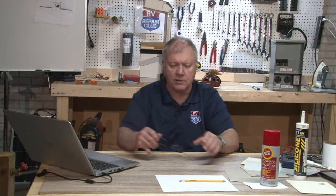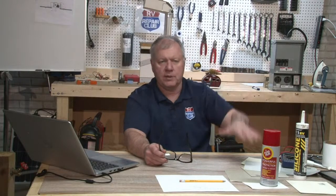So you have to decide how much you are going to be dry camping. You can get by with a 12-volt if you first of all get the right amp hours, you're comparing the two, you get a good battery and you condition it properly. We talked about sulfation before, and both of them are susceptible to that. We're talking lead acid batteries in this case. That's kind of Winnebago's philosophy: when you charge the 6-volt batteries, they gas more, the water level goes down, and most people don't check their battery levels. So now you've just negated what would have been an advantage, because when you let it go down, it sulfates. Their theory is that the 12-volt will work just as well if you maintain them properly.